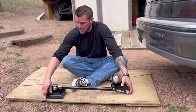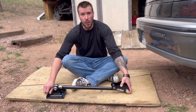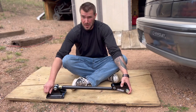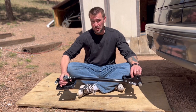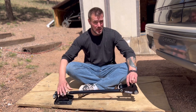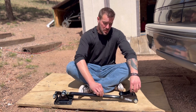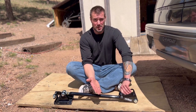If you're learning from me, I'm sorry. But what these things do — this bolts to your axle, this goes on the leaf spring. So when you actually burn your tire and it seems like your car is about to fall apart, that's wheel hop. In a situation where you have these installed and you try to burn your tire, your axle is going to want to wrap, and it's going to transfer that movement through this bar into this component, pin your leaf spring down, and prevent axle wrap.